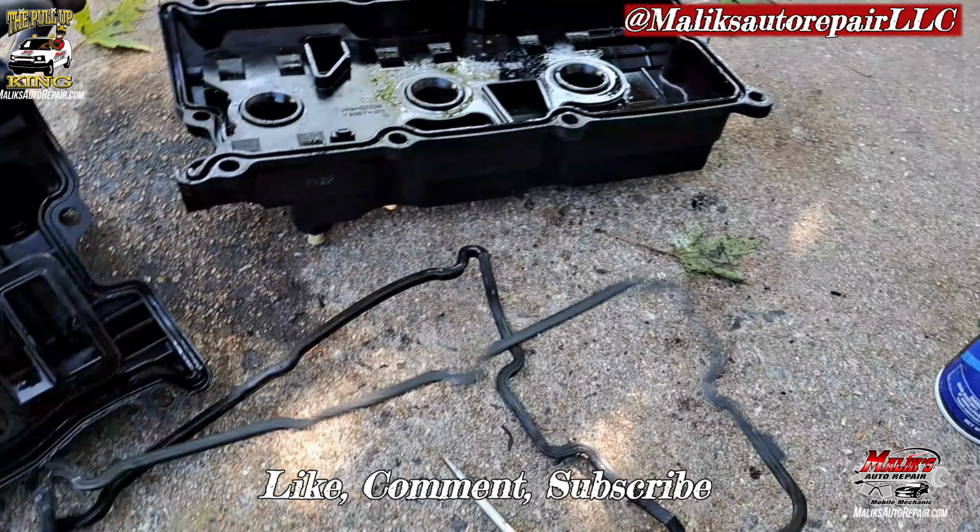All right, so I wanna go ahead and take out this air intake. I'm gonna take out that harness, mass airflow sensor, 10 mil, loosen that up, 10 mil. Got a clamp for the hose. Flathead or 8 mil. Another 10 mil. Get it on out. Right. Got better access to what we're doing.